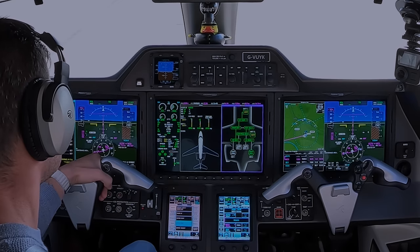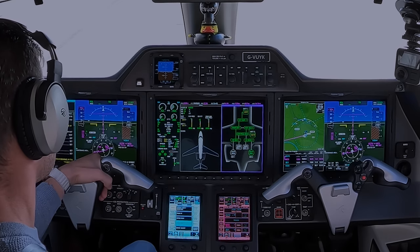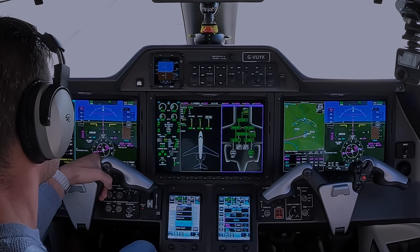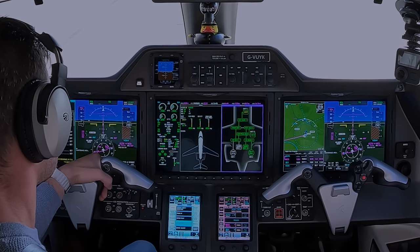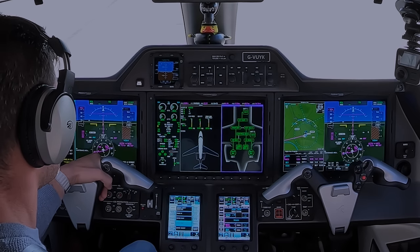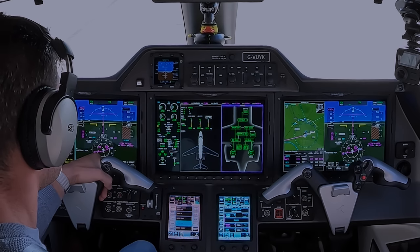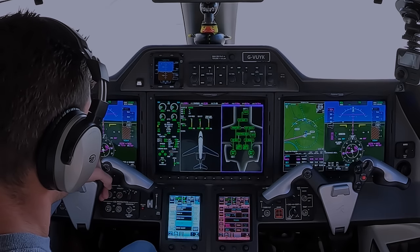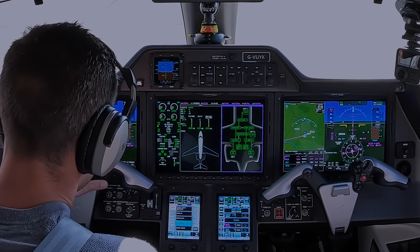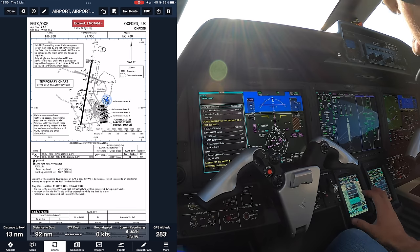Voltages look good. And that's a good start. N2 stable, we're up 52%. And on number 2, that's spooling down. Now I can restart the stopwatch there and continue with the after start check.